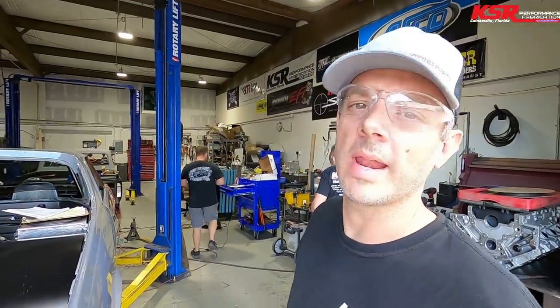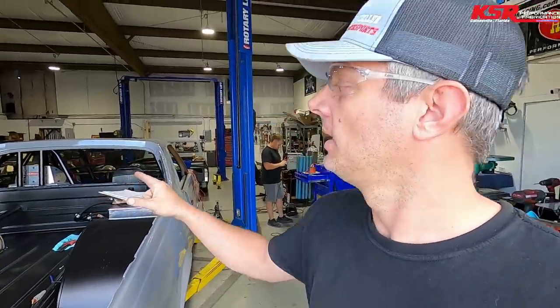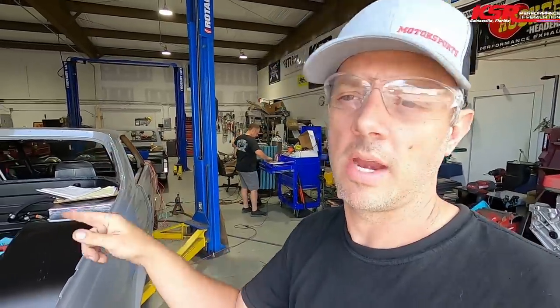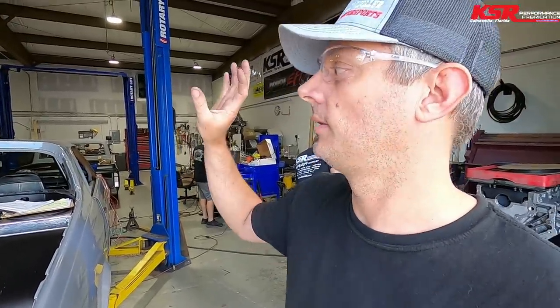We are plugging away at everything, as you've seen in the time lapses that you guys love so much. So I'm gonna jump in the back and cut out those rust spots at the back of the windows, make a little patch to just braze in there, and then I'll probably just seal it with some panel bond just around the edges so I can dust some paint on that. And then I think the guy's coming hopefully tomorrow to put the rear window in.